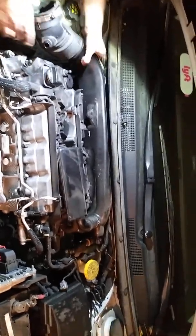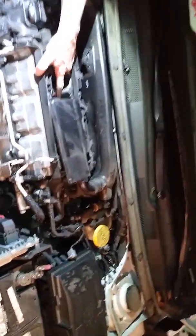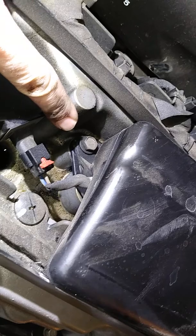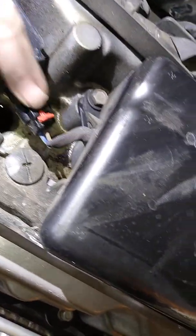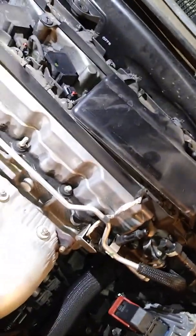So now we've got that piece off, so what we have to do is continue. There's another 10 millimeter bolt around this corner, right there. And these are the little clips we'll deal with — this little red thing. We'll deal with those clips in just a minute. I see why it's good to keep paper towel. So let's pause the video and I'll take the rest of this housing off — just this 10 millimeter bolt.